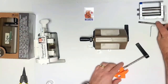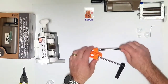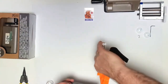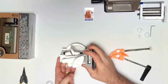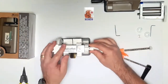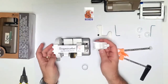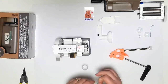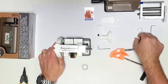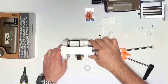After all the screws are in, go ahead and flip it over and check your function. Next, put your other gears on — one good way to line them up is to turn the bottom one until they line up. The next step is to put your gear handle together, making sure that this rod goes through this hole. You have to move these parts back and forth so the gear fits inside and the rod fits just like that.